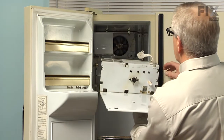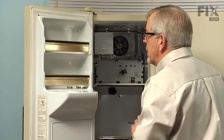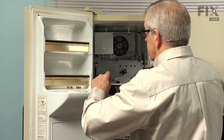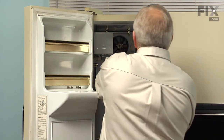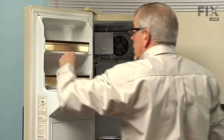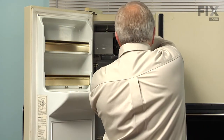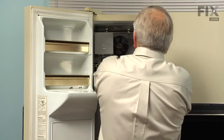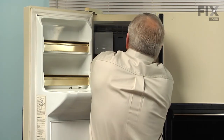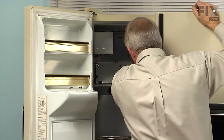Now to reinstall, we're going to slide that whole assembly back into place. Then we'll hang it on the two brackets at the back, and we'll support that until we can put a couple of screws in place. Remember to reconnect the wire harness — make sure it's fully inserted and install the two retaining screws to the connector and the two short screws at the front of that shelf. Then we'll carefully fit that evaporator cover in behind the ice maker, keeping the top portion of it in front of those two mounting clips. Tilt it forward enough so that we can slide it onto the tabs at the bottom.